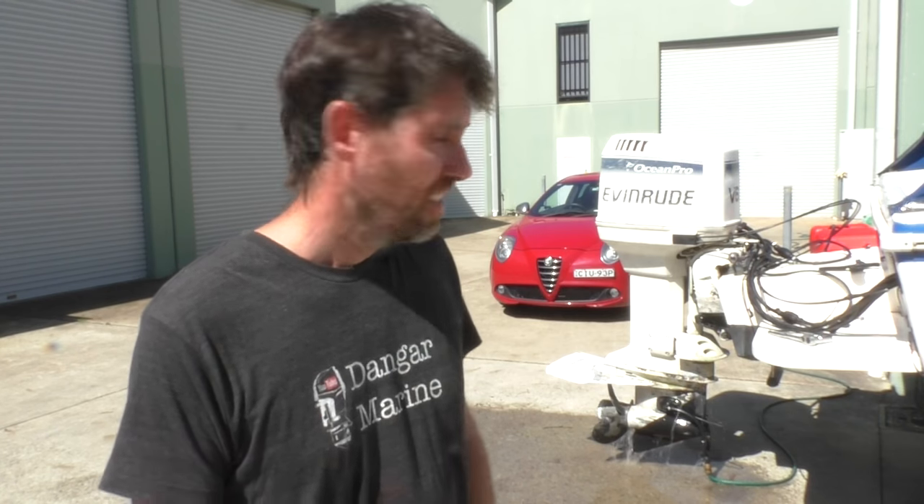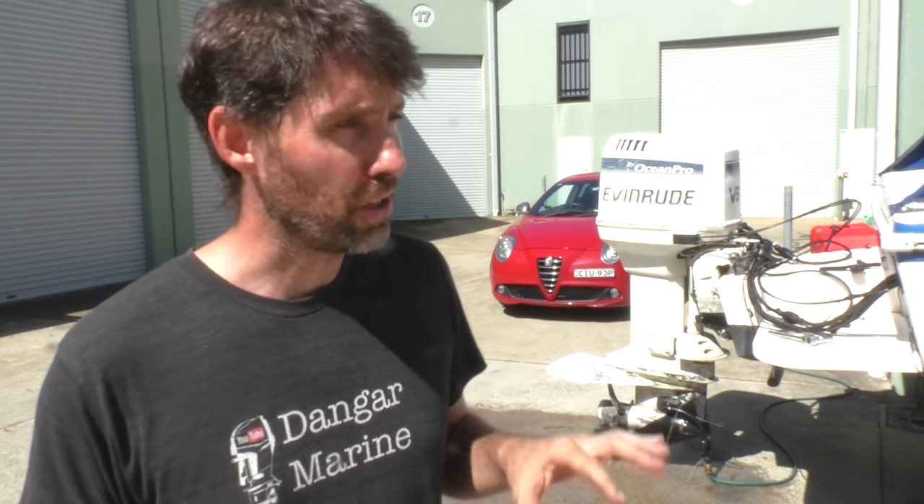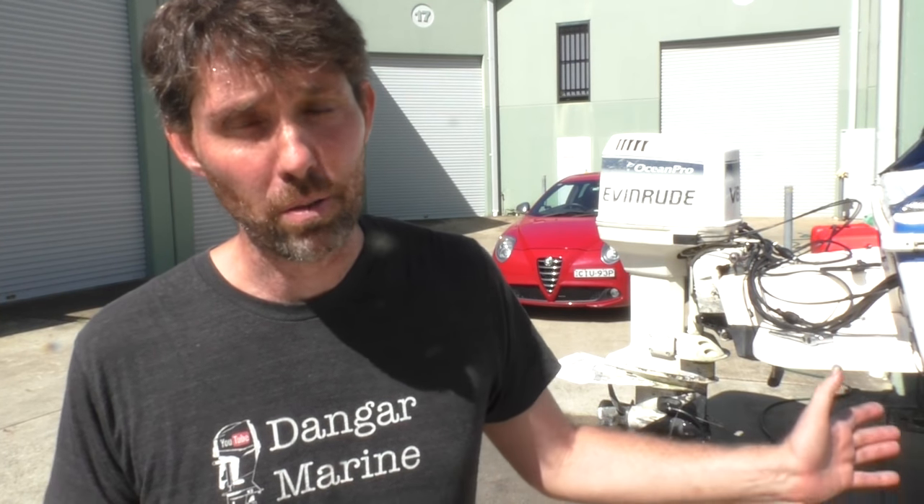Thanks for following along with this one. It's not quite over — we'll do the tune-up and we'll get on the water. But that's it, from having exploded to started again. I think it's been fun, and it's good to show how badly damaged a motor can be and how it can be brought back to life. Once this is tuned up properly, it should be as good as it ever was. I'm not saying it was cheap — all up it was about $2,500 for the engineer to re-bore and supply the pistons. On top of that, I probably spent about another $500 on sealants, gaskets, thermostats, and all those bits and bobs needed to put it back together. We're not even quite done there, because I will get some new carburetor gaskets and look into re-jetting it as well. But at the end of the day, it was either bin it, or spend $3,000 and have a perfectly good 150hp motor — so to me, it's money well spent.